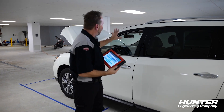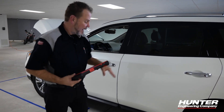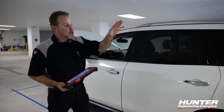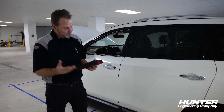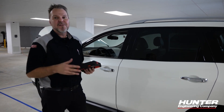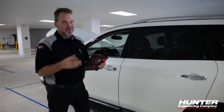At this point I've done the fine tuning of all four cameras after the initial calibration on the right side passenger camera. It kicks us back out and our post-scan report is saved as well. We successfully calibrated our right side mirror on the around view system and went through the fine tuning of all cameras while the grid was set up — that's a good practice. Don't tear it down and find out you're a little off. Last thing: put it in reverse, make sure the screen lines up and everything looks as it should before returning it to the customer. Print out and save your post-scan report. Head over to the YouTube channel to find Hunter and all of their ADAS videos for the ADAS Link and DAS 3000.